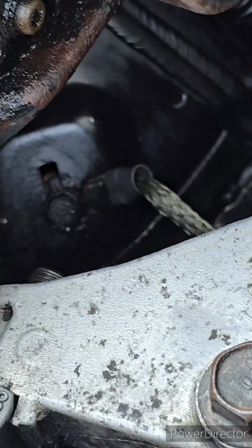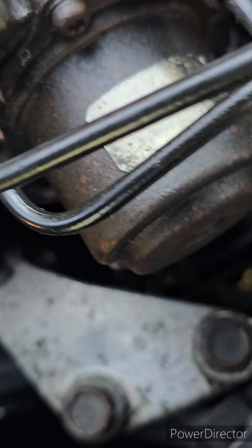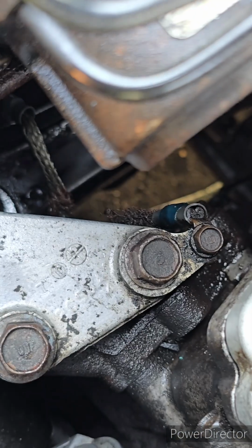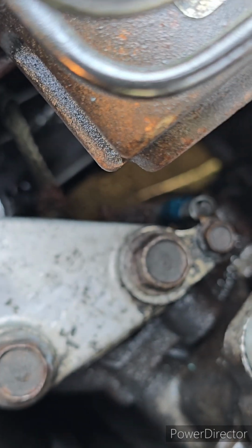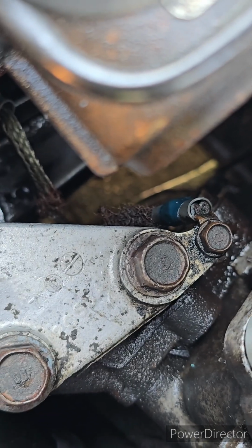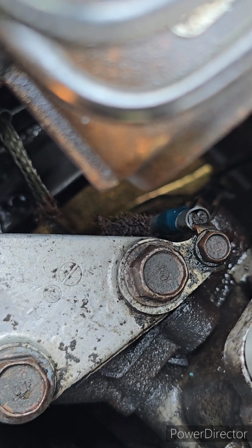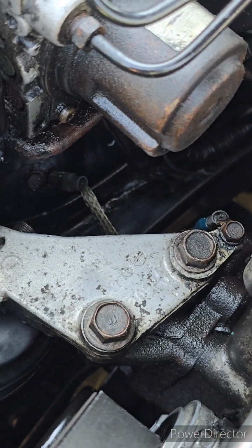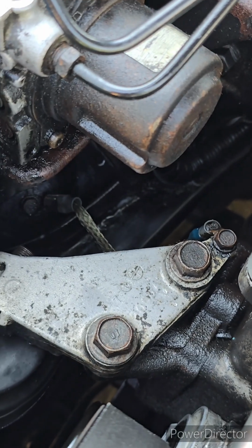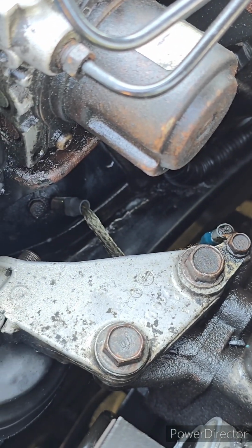the ground to chassis wiring harness there, because it looked like it snapped from there and it's just laying there, or maybe it's just saying good night and goodbye. So I gotta get the ground for that. That is basically chassis to ground right there, and to me that looks very insufficient. Even if it is the 4-cylinder, I want to get an upgraded chassis ground right there.